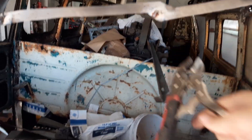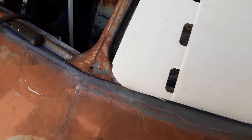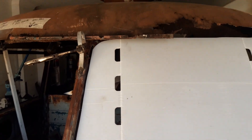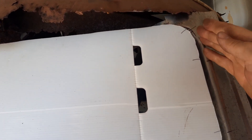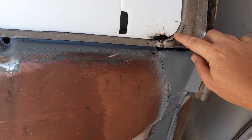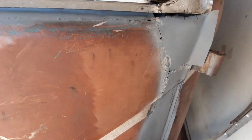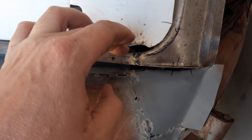That's good enough — let that go now. Let's just check that again to make sure it didn't move. Sit it up there. Yeah, looking good. As I said, there's a bit of fudge room up here. I've really got to tune this corner right out, and especially down here too — this is way out, I've almost got a full centimeter of play there to really knock that down. I'll probably come in and just cut this all away, then hammer-form just the slight curl on the edge, then come back with another piece of metal and fill that in at a later date.